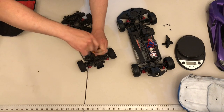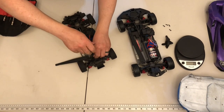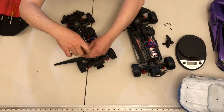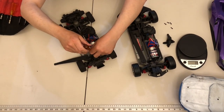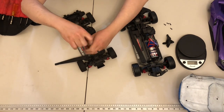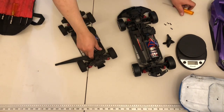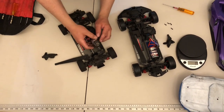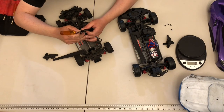We're gonna see this one over here. It may actually be somewhat similar. Maybe I'm thinking 19 because that may be the Slash pinion. Keep in mind that this motor is used on many Traxxas vehicles. All the base models have this motor for non-crawler vehicles. So if you look at short course trucks, small monster trucks, and by that I mean the Stampede, they generally have this, so Slashes, Stampedes, Rustlers. This is much larger. I can already see that it's much larger. I don't have the number. All right, let me try it again, see if I don't skip a tooth.